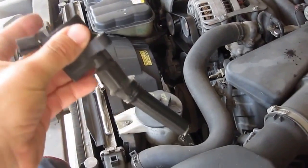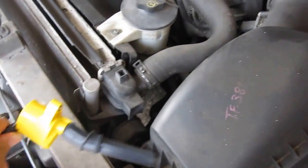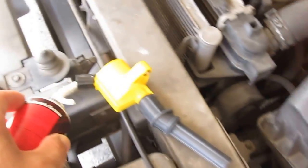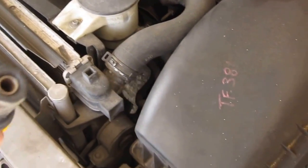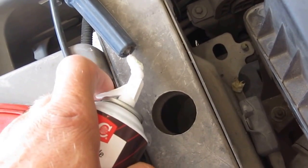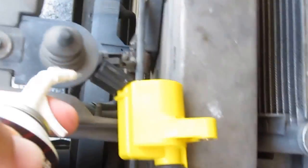There's the old coil pack. For the new coil pack, I like to put some dielectric grease — this marine grease — squirt some into the bottom of the new coil pack and some on the electrical connections. There are metal coils in there, and the dielectric grease keeps them from getting corroded if any water builds up in the bottom of the spark plug hole. Squirt some in there, and put some on the new connector.